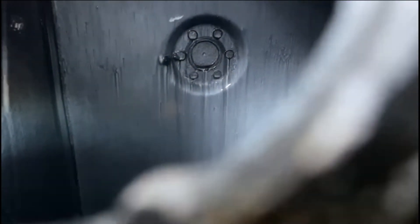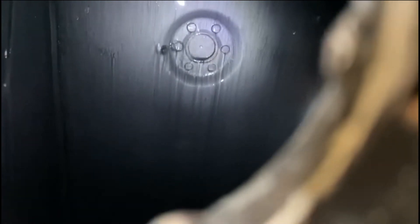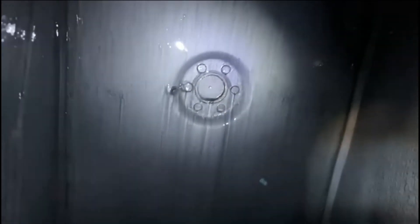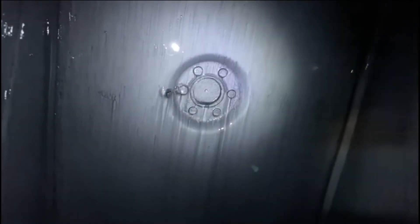I have coated the tank with this sealer stuff - amazing stuff, it's pretty good. I was a bit concerned about not having enough since I only got the motorcycle tank kit, but for a Land Rover I think it's fine because the tank is square and rectangular - not a complicated design. As you can see all the way around, even the top is coated. Petrol doesn't stick to it and it doesn't come loose - it is an absolutely sealed tank now with no rust. We should get nice clean fuel out of a 50-year-old tank.